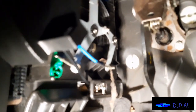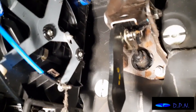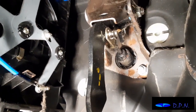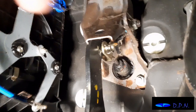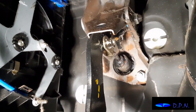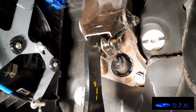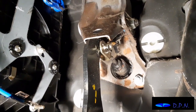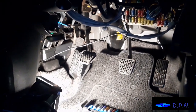What I've done is got myself in at a better angle after showing you what we've been doing, and hopefully you can now see the clutch pedal down here, and if we follow that up in there, hopefully you can just about see that, and you can see the master cylinder coming through. And what we'll need to do is remove that pin that is holding the master cylinder to the pedal, the fork that goes each side of the pedal, and also we can access the bolts from this side as well. So we'll get that done, and then we might be able to even show you a better view of that once we've got it out. And if we're doing anything under there, I can get a view in there. I'll try and do that as well, and I'll just pull out there so you can roughly see the relationship of where we work, and that always helps just a little bit.